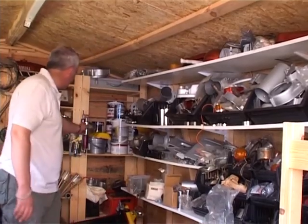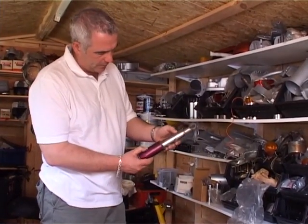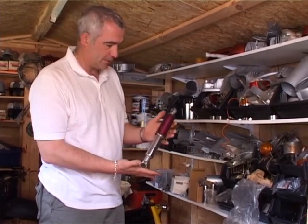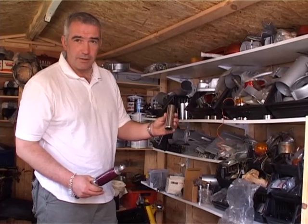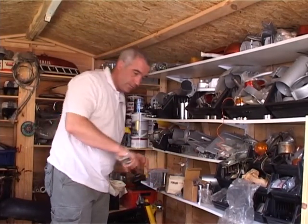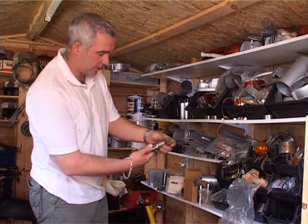On the shock absorbers, one of the biggest problems is the chrome sections, rust. And Yamaha only sold those as a one-piece item. So I've been buying Honda shock absorbers from breakers yards, and they fit exactly the same. So you can strip them shock absorbers down then? Yeah, there's a nut on the bottom there, you undo that, and pull the whole thing to pieces.